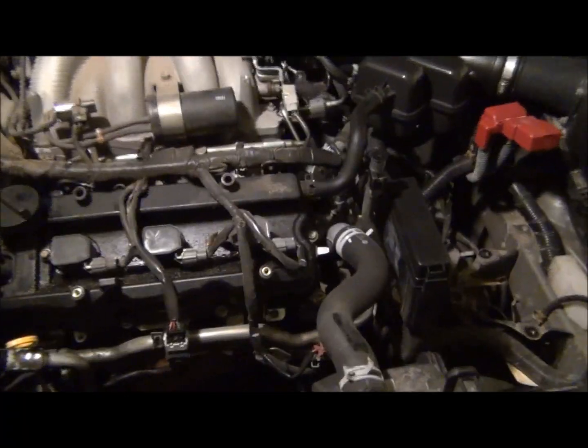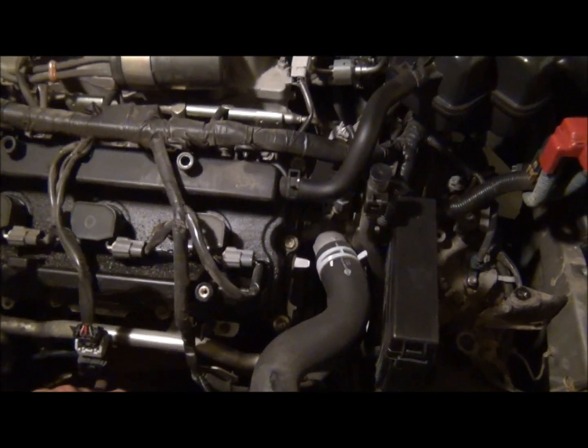So anyway, I drained the oil first and then the power steering so that I can dump all that in together. And since I don't have the other one here, I want to get that stuff done first. I can clean out a little brake clean, and then I can drain the coolant into it and just set it aside until I bring my jug back. But then we're going to drain the coolant. I'm going to move the upper hose and get the fan assembly out of here.